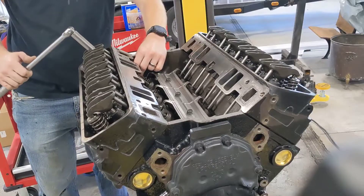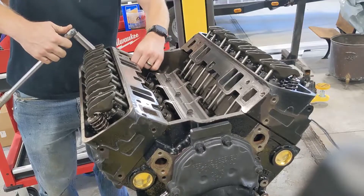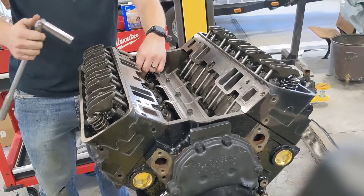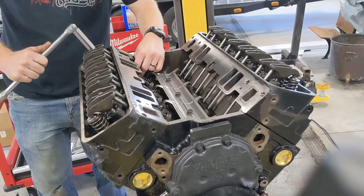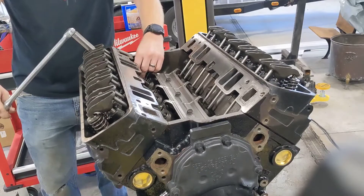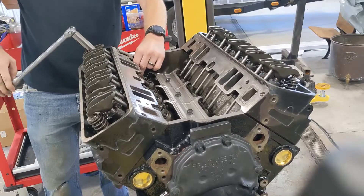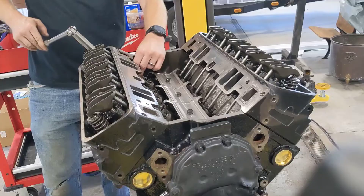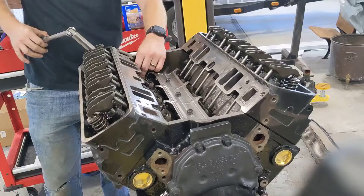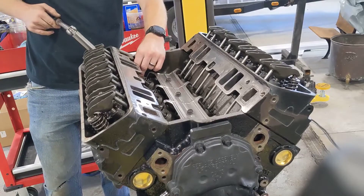Hear that chatter. The big thing is don't push your socket down onto the rocker arm. I haven't turned at all and the play is gone — if you press down with your socket, get your socket too deep on that rocker arm, you're going to think that the play is out. So I typically go right before I touch the washer under the nut. Get a little bit of tension on your socket, jiggle it up and down, and start turning your breaker bar a little bit until that play is gone — just when it stops. I like a breaker bar because I can back it off again.